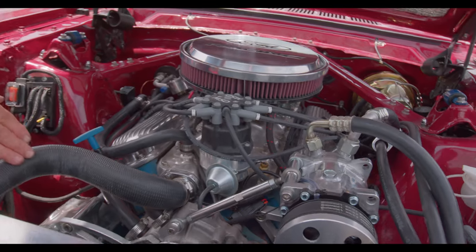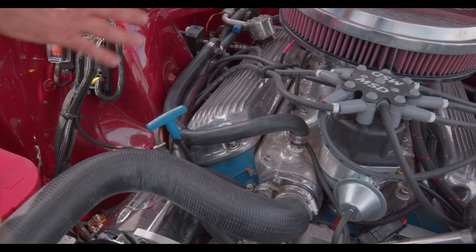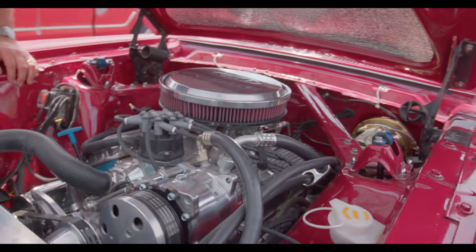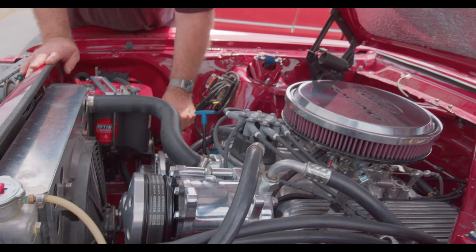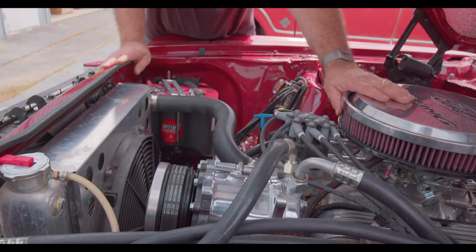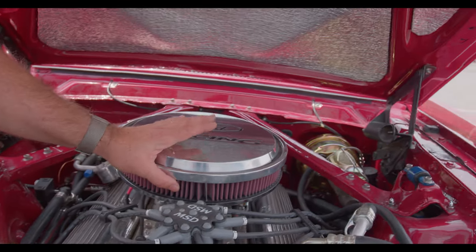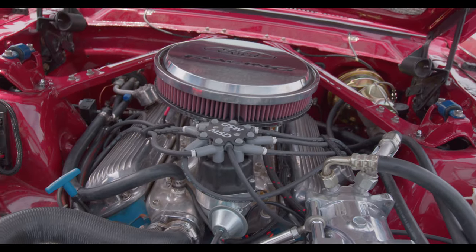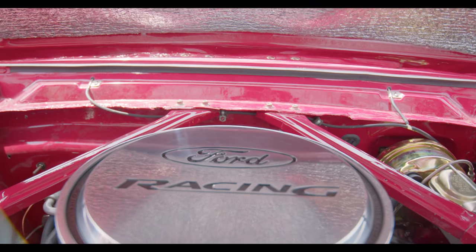What we've done in here is we reconfigured — we ended up doing a whole new wiring system, but the AC system was out. We had to change just about every part in here, including the kit. The alternator and wiring were fried, so we took care of that. When we went to test and tune, this was actually a cheap EFI unit. Everybody thinks EFI is the way to go, but it's not really — if you understand carburetion, how to calculate the proper CFM, you can just set it and forget it.